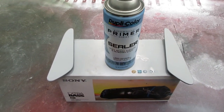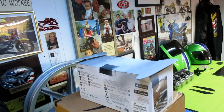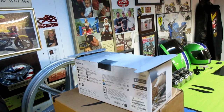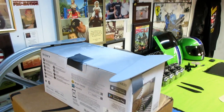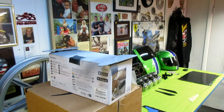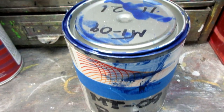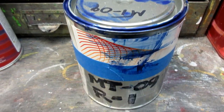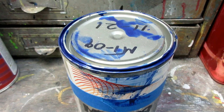It's very cold out here - looks like snow any minute, they're predicting snow, but so far none. That heating vent is our best friend - it's going to sit there a while, usually half an hour to 45 minutes, and it's got to be dry to the touch. It doesn't look like we have any fisheyes at all, which means we're very lucky - sometimes fisheyes can make you crazy. Then I'll spray the blue. This is the dedicated blue that Dennis mixed up for us - it's been a pretty good match. I'm going to mix up a small batch for the small gun just to do these two small pieces.